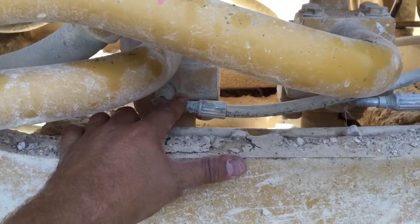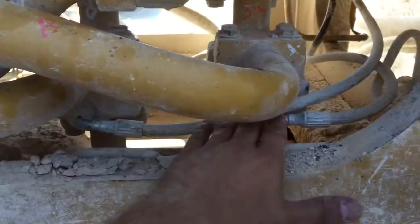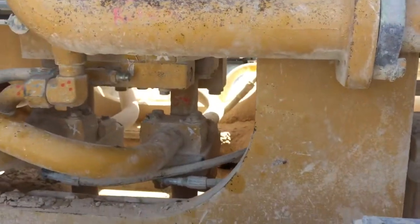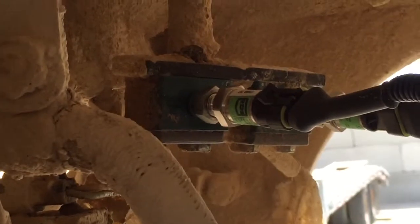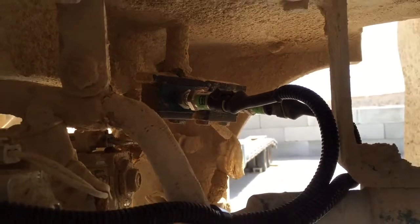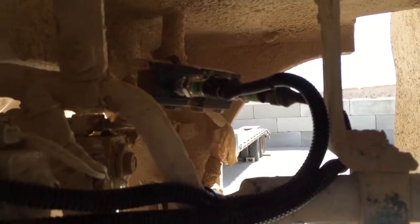Loop does provide the appropriate fittings to put your pressure sensors into these ports in the event that the hoses aren't there. These hoses run directly across to a clamping bracket that we're able to use the other end of the hose to fasten to our pressure sensors. There's a quick disconnect cable that goes into the end of those pressure sensors.